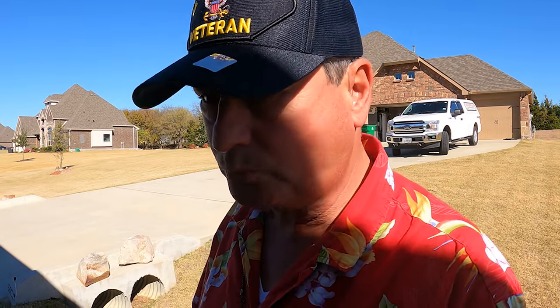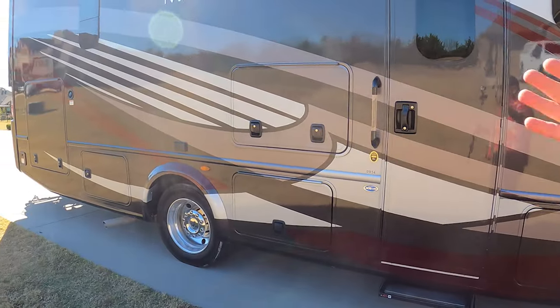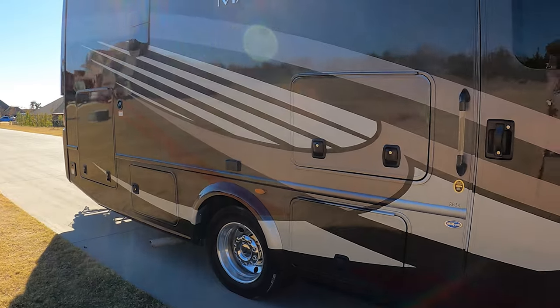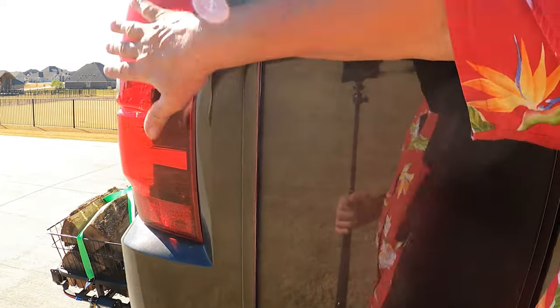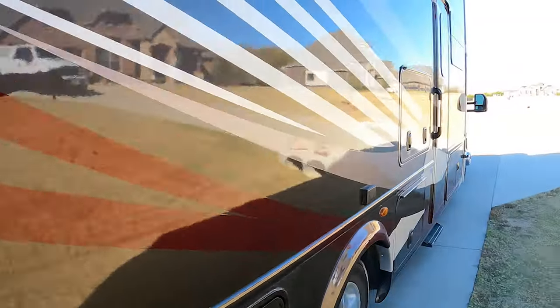the darkness of these two different, one was a state park and one was a Forest Service campground. Both of those locations were so dark, I could not tell where the ditches were when I'm making my turns. And I couldn't tell where the rear of my coach was, because you gotta allow for your tail swing. And there's only one marker light here, and it does nothing to tell you where this is, because you can't really see that from your mirror.